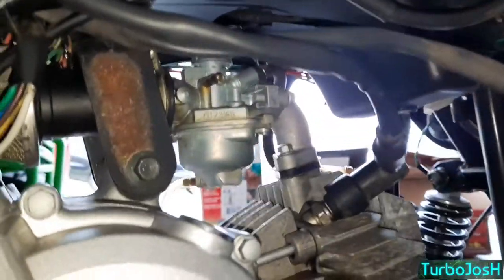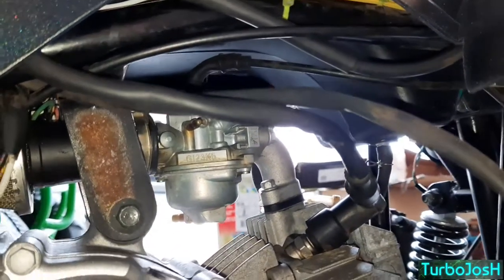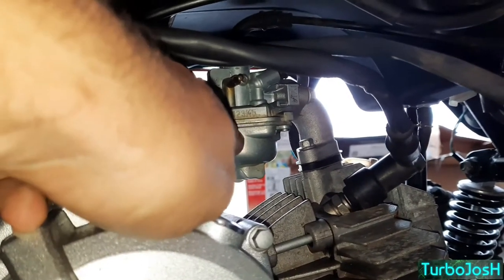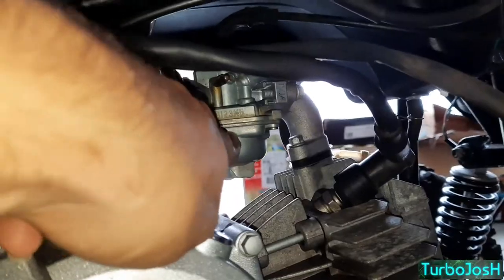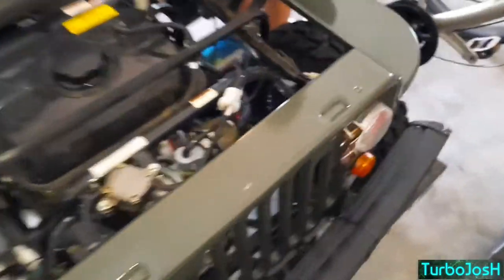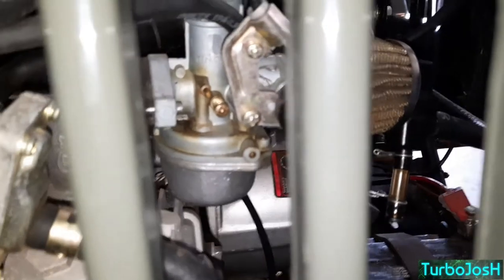When I say a Chinese carburetor, this is a Chinese carburetor — we call it that because the bowl, one of the first options you'd take off, is right here and you can't remove it; it's fixed. This carburetor is on the mini jeep, the 125cc three-speed semi-auto mini jeep, and you can see the bowl is sealed. This is a sealed carburetor that cannot be taken apart.